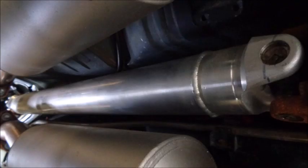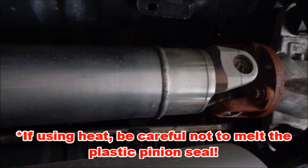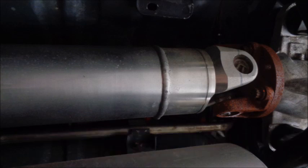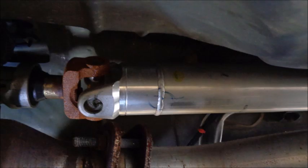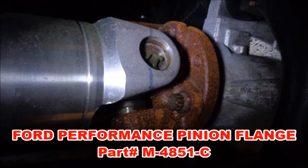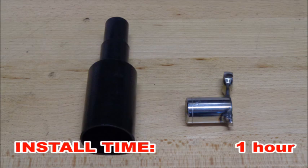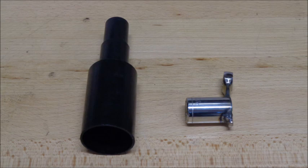The Ford Racing aluminum driveshaft is a very well-made part. It doesn't come with instructions, but it's an easy mod to tackle yourself. Having said that, sometimes the driveshaft bolts can be really tough to break loose. Penetrating oil or even a little heat can help. Just be sure not to melt the rear-end pinion seal in the process. If you're doing an IRS swap into a V6, you will need to shorten the driveshaft by about an inch. Because the T5 has a 28-spline output shaft, you can't use a Cobra-specific driveshaft. A local company cut mine down for $150. You will also need to change the pinion flange on the rear differential. The Cobra flange has a wider diameter bolt pattern, and the holes won't line up with this driveshaft. It helps to have a tranny plug to prevent fluid from leaking out during the driveshaft swap, which takes about an hour. I've found that it's impossible to get a straight shot at the driveshaft bolts with a torque wrench, so I welded a socket to a 12mm closed-end wrench to get the access I need.